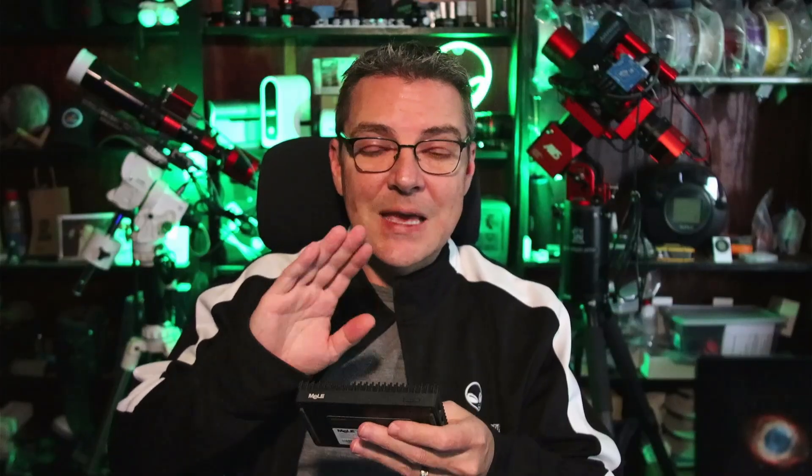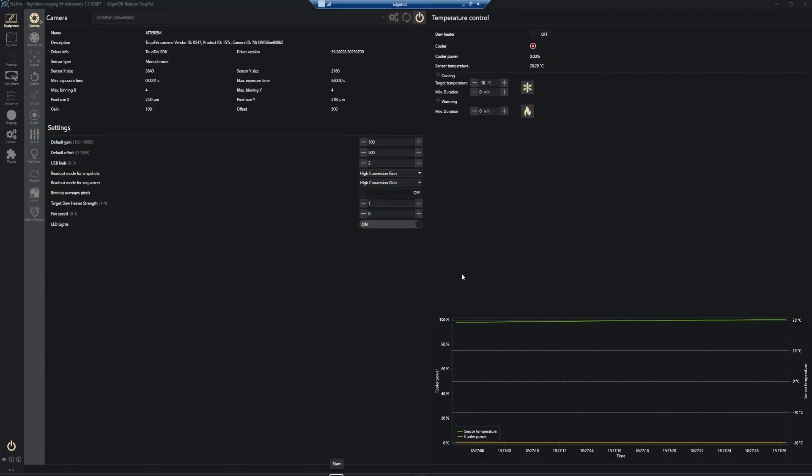The auto power-on feature is really useful for my observatory setup since I can turn power on and off remotely from my office, allowing the computer to boot automatically without having to go out there. Windows 11 Pro is important because I use RDP — Microsoft's built-in Remote Desktop — which requires the Pro version to accept incoming connections. Without Pro you'd need third-party software for remote access. I also always remove any stickers from the top before use, as I feel they can trap a little heat.